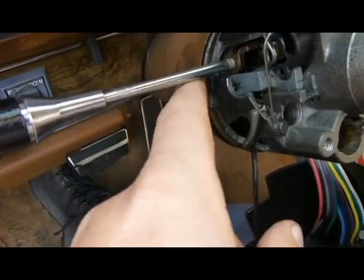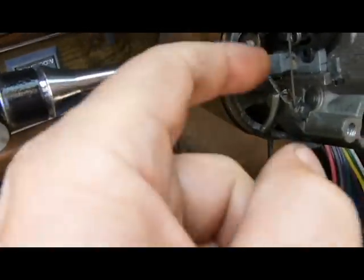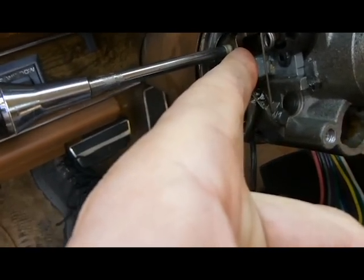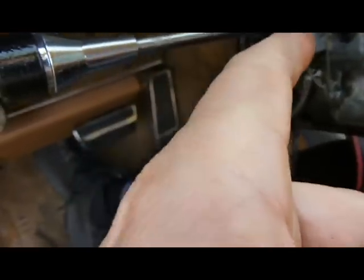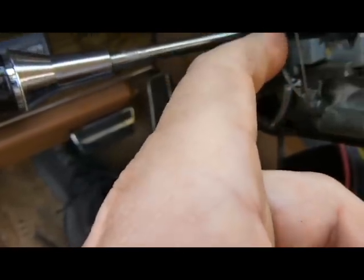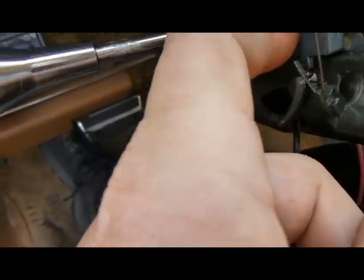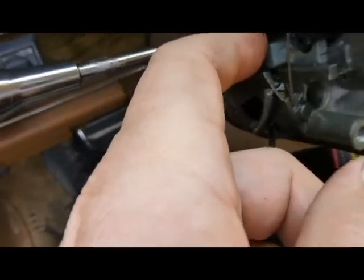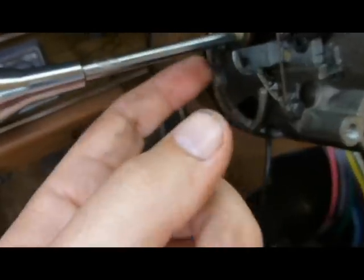Well, what you have to do is down in here, there's a little nub that it has to go over. There's a rounded area on this part right here that has to go over that. It'll get on top of it instead when you're putting this together. Which will mean when you're doing this, the key isn't actually on the switch down there. So it'll turn on as far as the key turn on, but it won't click or anything because it ain't actually activating the switch. And you'll know it's wrong because it won't really turn all the way to the off position. It'll get right at it but not off. And surely no auxiliary, because it's above the switch instead of on it.